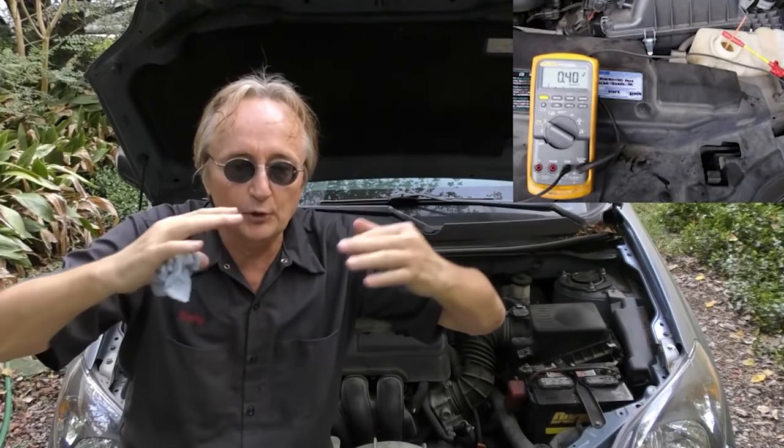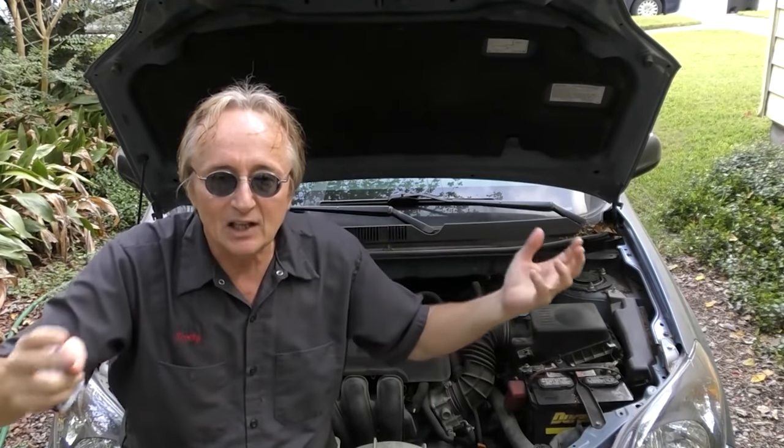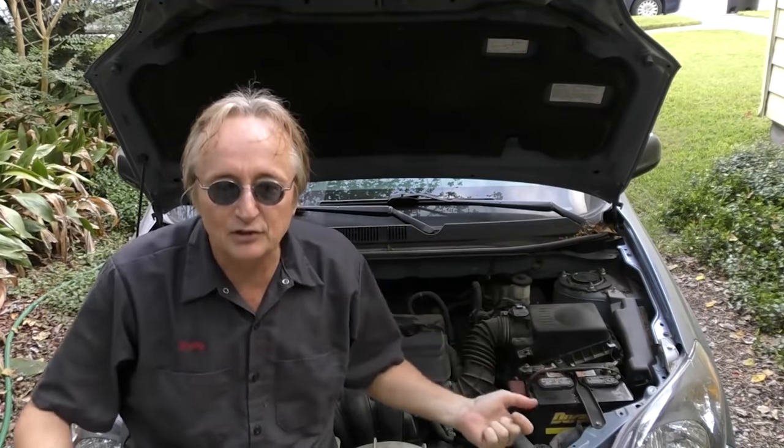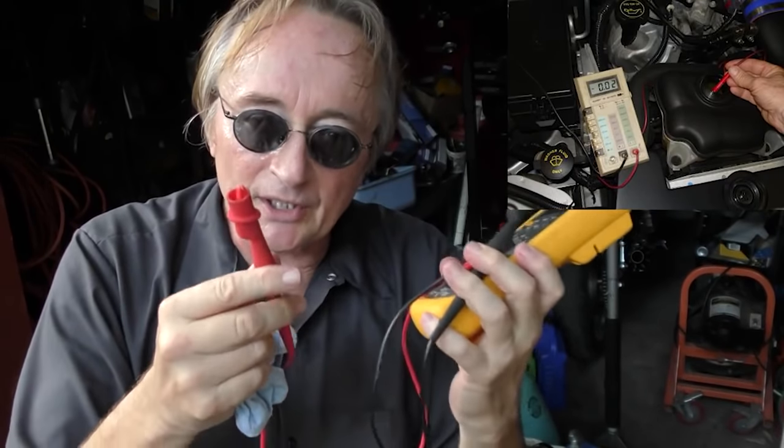With modern computerized cars, degraded coolant actually creates a battery voltage inside the cooling system. That voltage can destroy the electronic system and computer sensors, making the car go haywire. I've had customers with exactly this problem - I stick my meter in their coolant and the other end on the battery terminal and find voltage flowing through the coolant. That destroys components. It's not hard to change the coolant yourself, but you have to do it if you keep the car a long time, to prevent electrolysis from occurring inside and damaging your car.